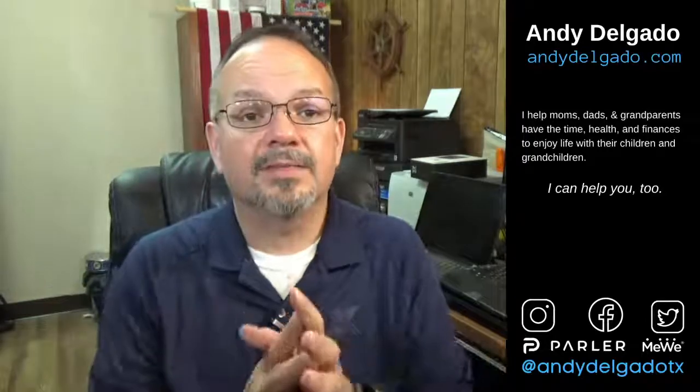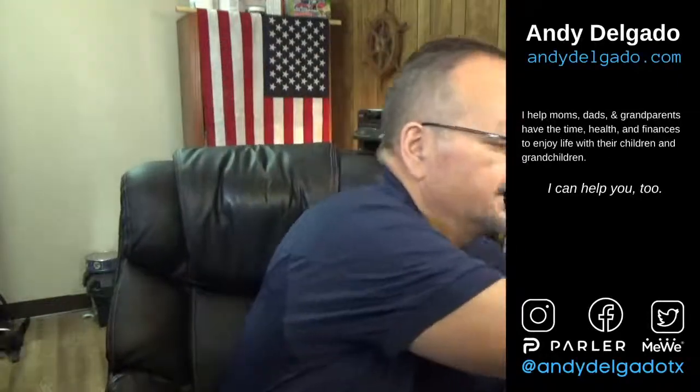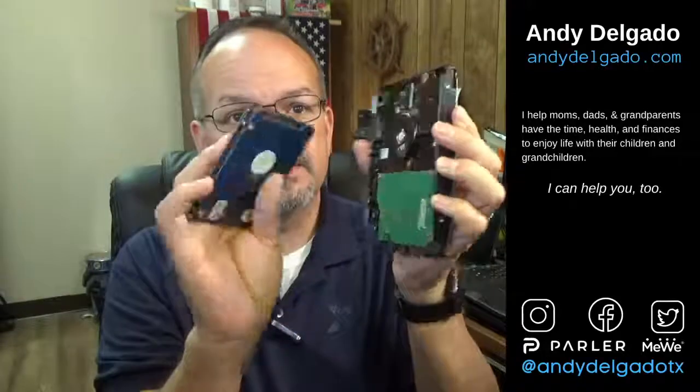So what am I talking about when it's time for you to donate your computer or throw it away or whatever you're going to do with it? Find this device or this device. Find either one of these, okay? Take it out. Typically, it only takes a number 2 Phillips screwdriver to get inside of a computer and take it out. Take that device out, then you can do whatever you want to do with the rest of the computer. You can donate it. You can take it to the scrap metal yard and sell it for a couple of pennies because it's not worth very much right now. Whatever you want to do.